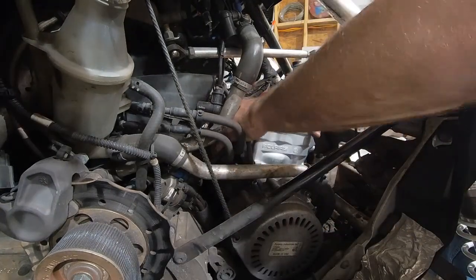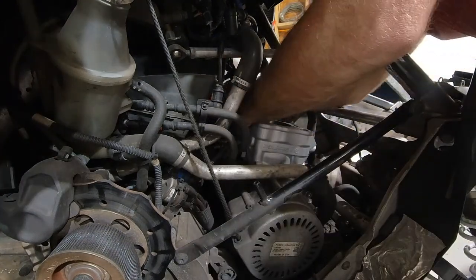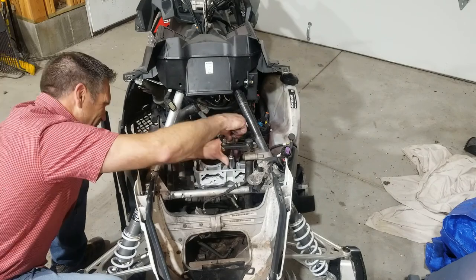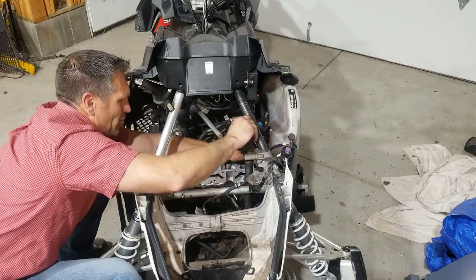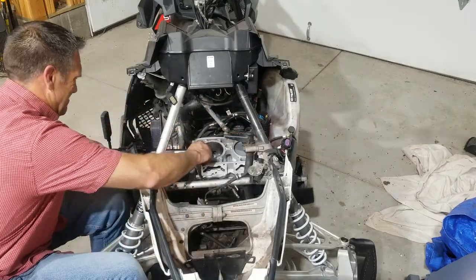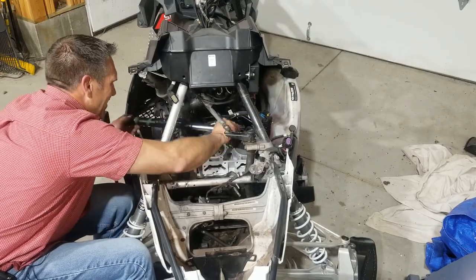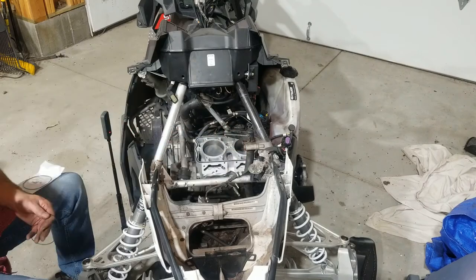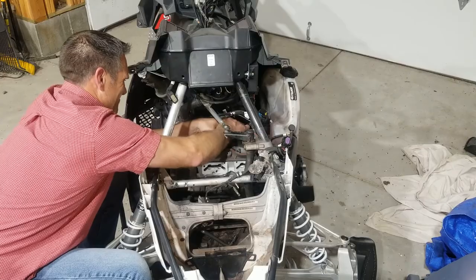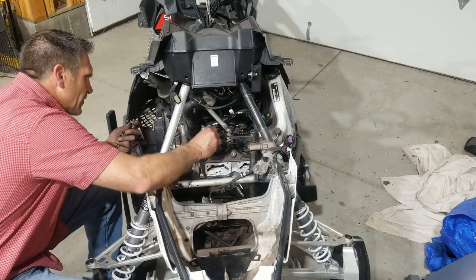What I'm going to do next is tighten up the fuel rail, only because if there is any complication in the injectors, then there's an outside chance the cylinder might have to come back off. So before putting those bolts on for the cylinder, I'm going to mount the rail. There's an official torque order on this stuff. But frankly, in this case, there are 8 bolts, and so the pattern is the same. You start in the middle, go from one side to the other, and then work your way out from the middle, alternating from one side to the other. And I like to go in little amounts, so I'll tighten it some, but not all the way on my first pass on each bolt, and then go back through and hit it again later.